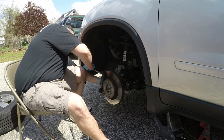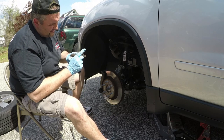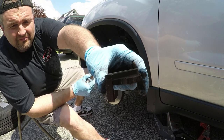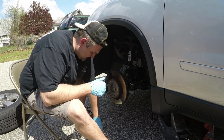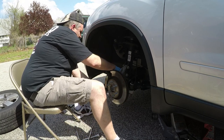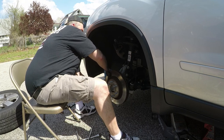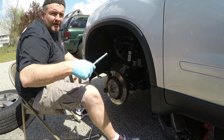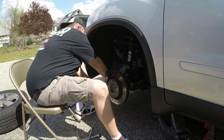You can see the strip for the noise — the low pad indicator. I can see all the pad I still have left on these things. Now that it's out of the way, I can get in with the wrench. I need to loosen from this direction, so I'm coming in low and putting an extra wrench on it for leverage — slipping a one-inch wrench over the handle gives me extra mechanical advantage. Boom, I'm loose.